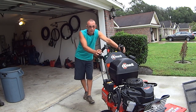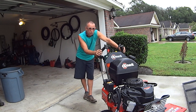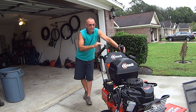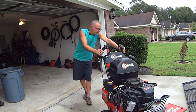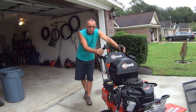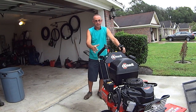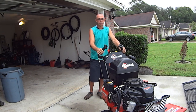I changed my mower oil recently — 20W-50 for these hot climates — and I went ahead and lubricated the cable. If you don't lubricate this cable, dust, dirt, and moisture get in there and it will break. The manual says to do it, so just do it. A shot of WD-40 or bicycle brake cable lube will work — get it in there and it'll work its way through. Proper maintenance, proper installation, and concentrating when you use it covers everything.